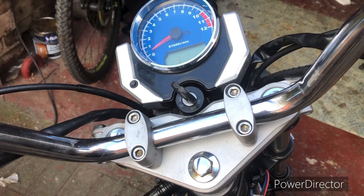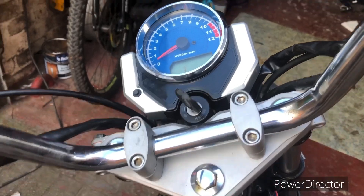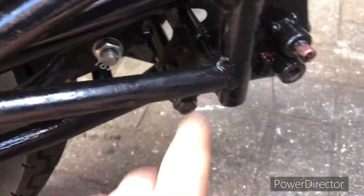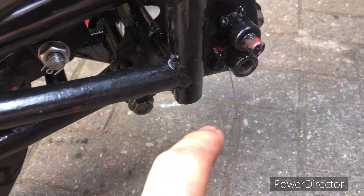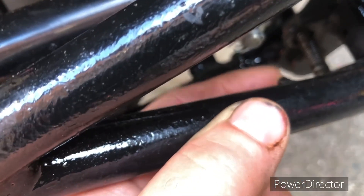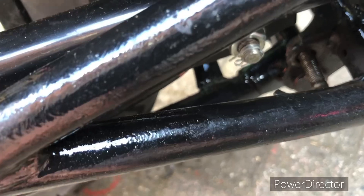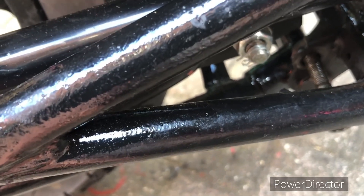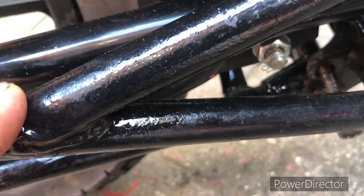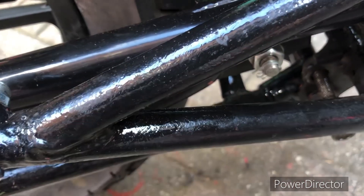Welcome back to part 8. After the problems on part 7 with the motor, we found another issue. I've come to assemble the rear brake and found there seemed to be no stop on the brake. Looking at other bikes with the same frame, there should be a stop welded on there - and there's a piece of broken mount. We'll have to recreate that with some welding, which means taking the swingarm off and the back wheel out for access. I did notice that before and ignored it like an idiot - I should have investigated it at the time.